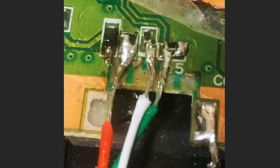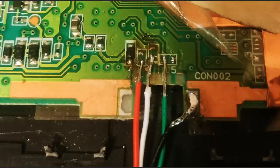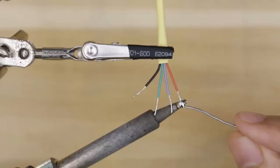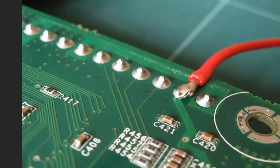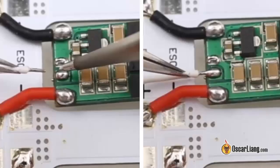As I've mentioned before, I am not an engineer and I have no prior soldering experience. As a result, my first attempts at soldering were extremely messy and caused all kinds of problems, shorts, and damaged the board. If I might recommend a singular piece of advice, there is a concept in soldering known as pre-tinning. Soldering likes to attach itself to solder more than anything else. Bearing that in mind, if you add solder to the wires in advance, you should be able to simply position the wires in place over where they should be connected and touch the tip of the soldering iron there, fusing the two together. This should allow you to connect them very easily and cleanly.